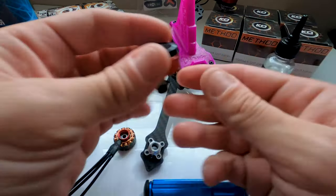That is the oiling process so far. Next, get your blue Loctite thread lock — I recommend the blue one — and put a small drop on the threads. That is all you're going to need. Get your stator and twist it to the right first so it catches the thread — you'll feel it drop in. Once you do that, tighten it down little by little. Then drop the bell back on and try to line it up, because it can come out hard.